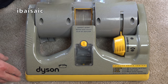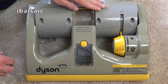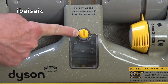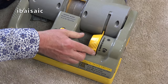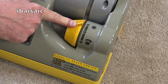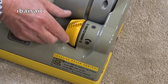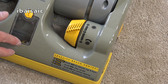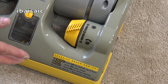Here's the cleaner head. You can again see the original grey colour here as opposed to the faded green that this DC03 has gone. In the middle of the cleaner head you can see a clear window - you can take that out by turning this screw, which gives you a bit of access inside if there's a blockage. This is the clutch control on this Dyson DC03 and you've got three positions: neutral, which is the brush bar off for delicate rugs and floors, so you can use it in the operating position but you'll just get the suction and the brush bar will remain static.